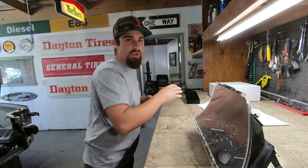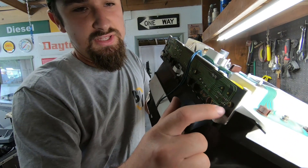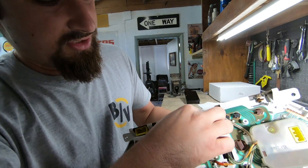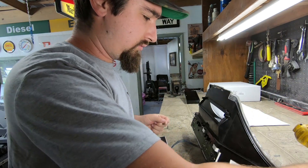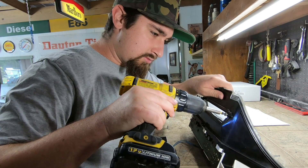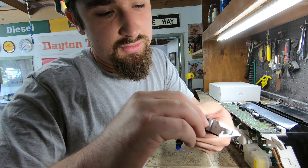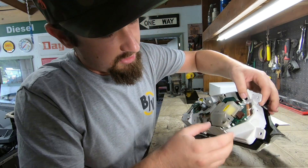I'm going to get this cluster pulled apart and then figure out how to get that black piece of plastic back there. We're taking apart a gauge cluster — Civics, Integras, they're all the same. We want to focus on getting these black tabs out from behind there, working our way all the way around. Then this back area should separate. I want to make sure all these connections are out as well.